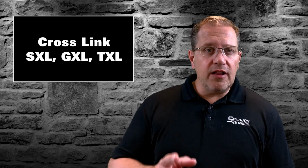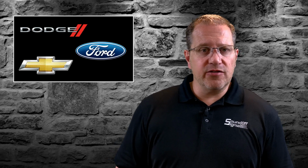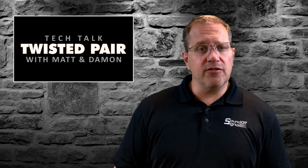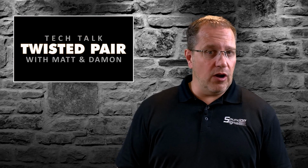Now let's get right to the bottom line. Crosslink wire is the wire you need to use for automotive electrical applications, especially in the upfitting world, because it is the wire that is specified by the vehicle manufacturers. In fact, TXL Crosslink wire is very commonly used by the automotive manufacturers because it offers high performance, it's extremely durable, and it's very, very lightweight relative to other types of wire, including other types of crosslink wire.